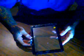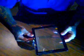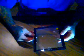Basically, it just came, no bezel, so we're going to use all the existing plastic housing. And it didn't come with any adhesive, so I just had to make do with some thick, heavy-duty double-sided adhesive, and we'll start by peeling that off. That's going to go on top of the plastic bezel that holds the digitizer in place.